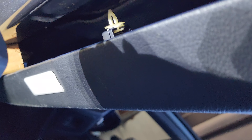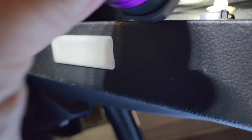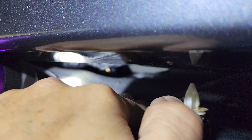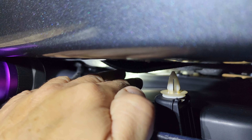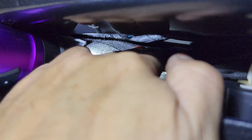And up inside of here you'll find your defective vapor barrier, and there it is. If it comes off like that, there's your leak. Mine's leaking bad. It should be glued up against here, but it's not. BMW uses butyl tape and it falls off just after a couple of years. There isn't even any residue on here — butyl tape is still on the door, sticky on the door but not on the vapor barrier.